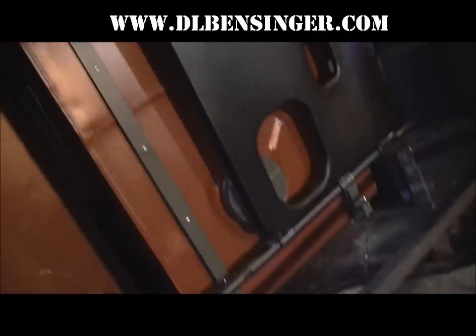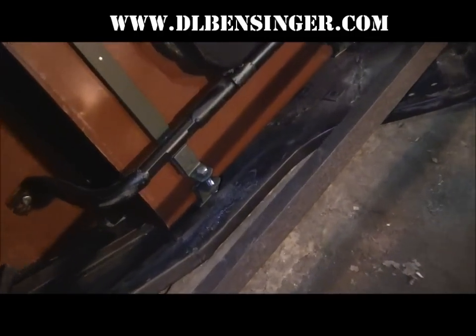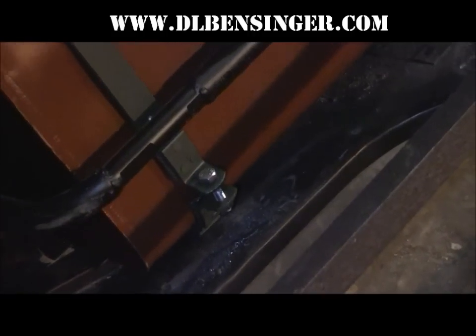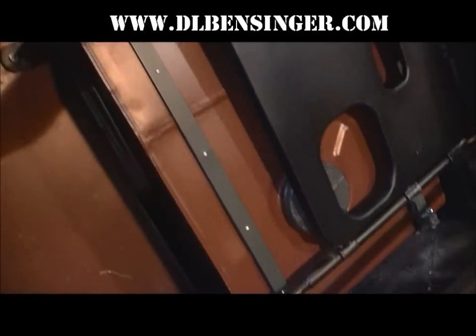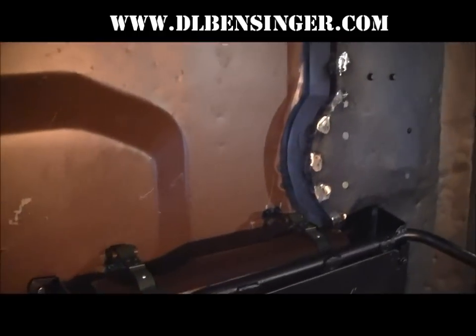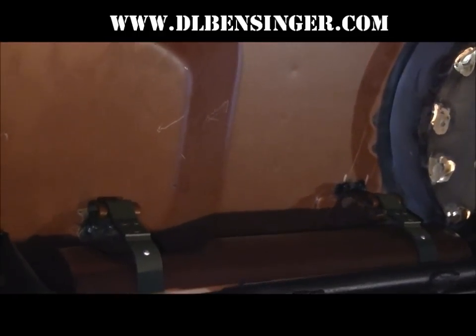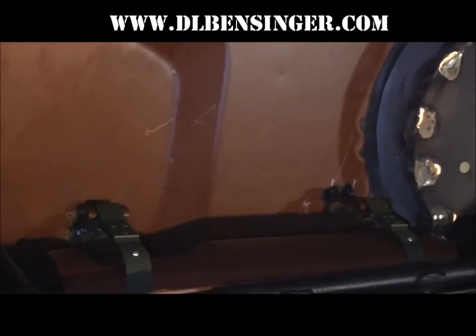We've got the straps on. The straps go to the side of the body properly. This all fits and works. Whether it's a front floor, rear floor, any kind of panel you're putting on, when you're doing something like this, you want to make sure that all those affected parts that go with it are going to fit and work before you go welding this floor in.